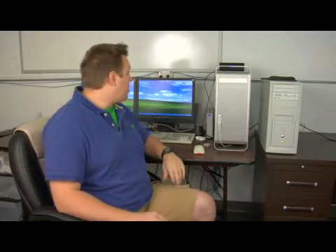First thing you can do if your computer freezes up is try hitting Control, Alt, Delete. It's like an override sequence you can use. Sometimes that alone will unfreeze the computer, but what it'll do is bring up a window with the Task Manager. A program you're running may have caused the freeze, so it'll show you what programs are running and you can highlight one, select End Task, and kill that program. That might unfreeze your computer and allow you to shut it down normally.